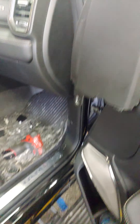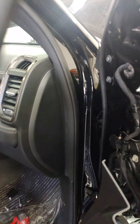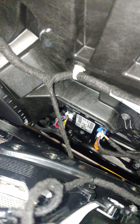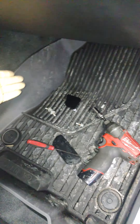I went ahead and removed this as well. Once this is removed, the two bolt studs in the back are exposed. Pop those out and the mirror will fall. The wiring harness loops all the way under the speaker and comes back to your passenger door module. That's it — nothing to it, really. All you need is a 10-millimeter socket and a pick or trim tool.